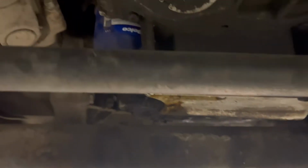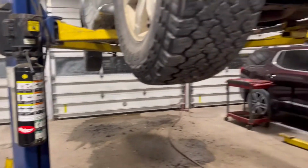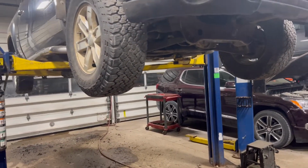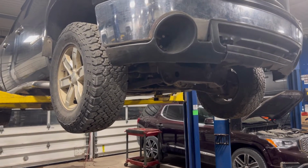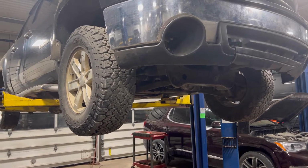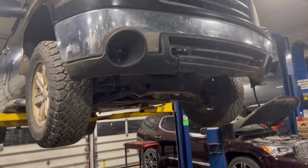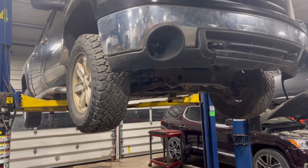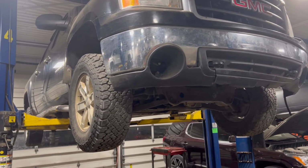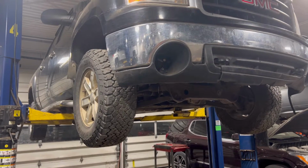Got the oil changed, got the transmission fluid changed. Checked the fluids before starting it up, and oil was good. Actually, it's perfect level. Looked like it had just been changed not long ago. Transmission was severely overfilled, so I'm assuming water got in there when they were putting the fire out, and or when I was pressure washing it, and I may be the culprit. I don't know. But I sucked that empty and then filled it back up with the correct amount.